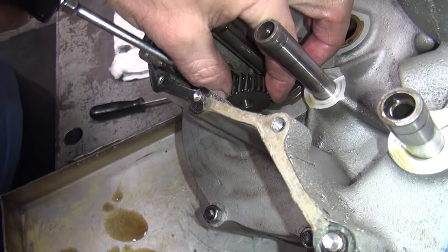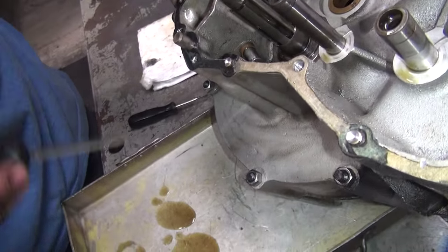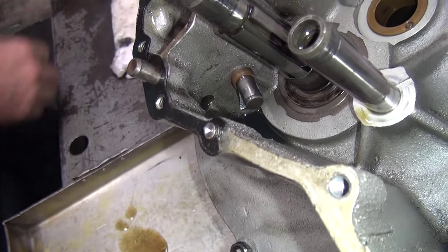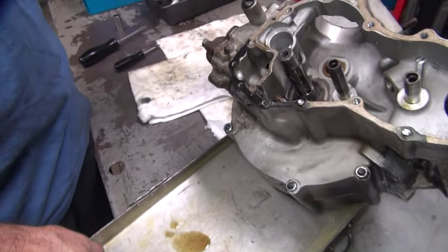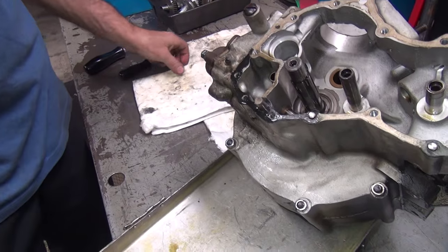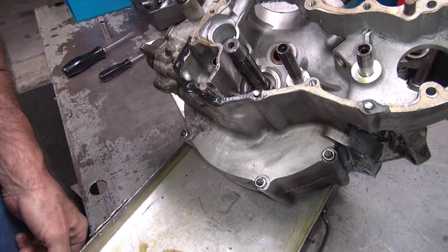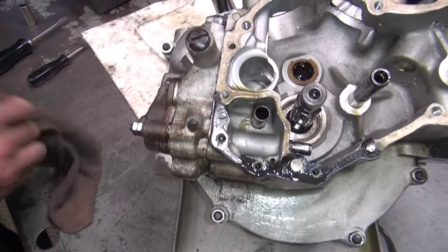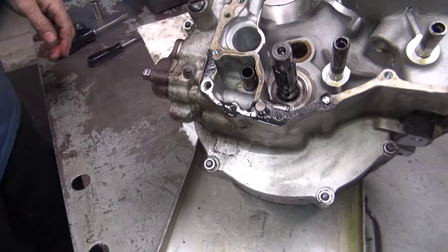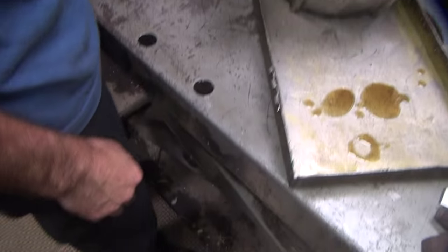Being a generator motor, this actually will come out — it's made to be worked on. Then you've got your — uh oh, drop something. It's down there in the hole. Okay, now this can come off here. This is my first generator motor. We can update this stuff — we can update a lot of stuff by limiting parts if you want. If you put a late shaft, a '55 style shaft, you can lose all this early crap and use late model parts. A lot better. We need an impact knocker.